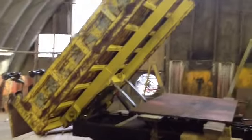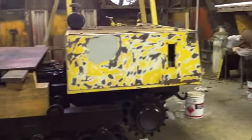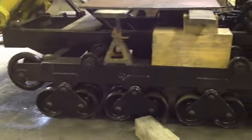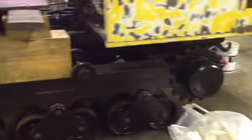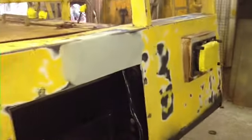Here we're in the paint shop where an 800 has been prepped for paint. You can see the black undercarriage has already been painted and this will be masked off. I've started prepping and sanding — you can see here a little bit of body filler. We try and keep the body filler to a minimum where possible, because it tends to crack after a while.